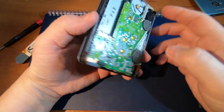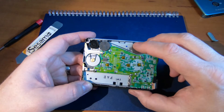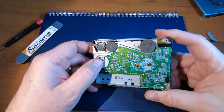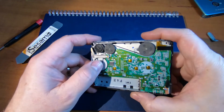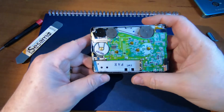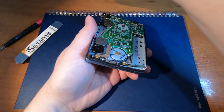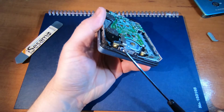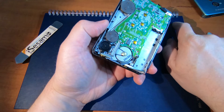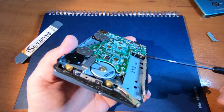Now I've got a good view of the belt. It is still intact and hasn't deteriorated too much, but it must be slipping because I could hear the motor turning but couldn't see the wheels turning. Let's look at the battery compartment first. We can see the two terminals powered by the external battery pack — one and a half volts there and the player works, but one and a half volts on the internal battery does not work. The battery terminal is looking in good condition and I can't see any corrosion on it.